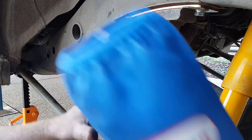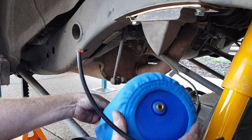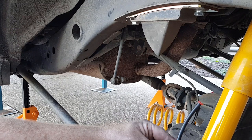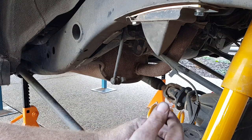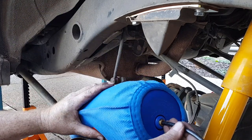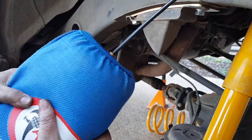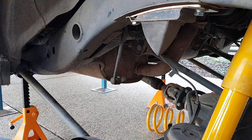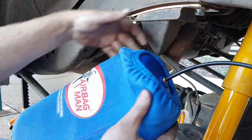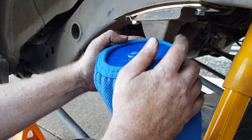So we're just fitting the airbags into the coils now. Take off a short bit of hose and add the little red plug that comes in the kit, then insert that into your fitting — that's in there nice and tight. Now, it shouldn't let any air out. Undo your plug, squeeze all the air out of the bag, and reinsert your plug. Now the airbag is kind of all sucked in and deflated — that's going to make it a lot easier to install into your springs.